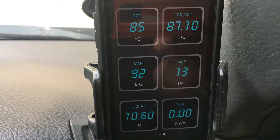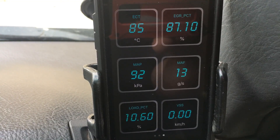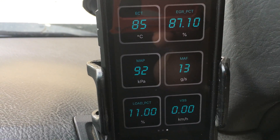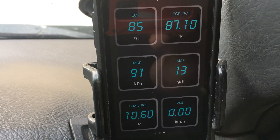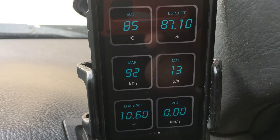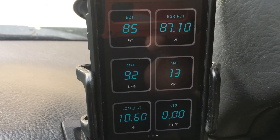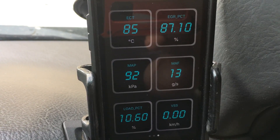As long as the thermostat's working correctly the rest of the time, which this one is. It's just got a head start — it's a couple of degrees warmer than it should be. Could even be a variation with a temperature sensor. But as long as when you're driving and using the vehicle you don't see more than 84, 86, 87 commonly — 88 is less common, 89 — we're getting into hot days when you're working it harder, because up to 90 is the normal operating range. The normal operating range the engine was designed for is 75 to 90 degrees.